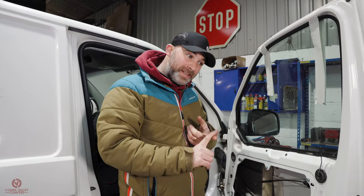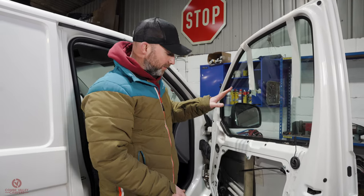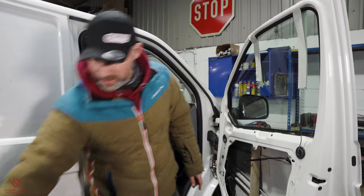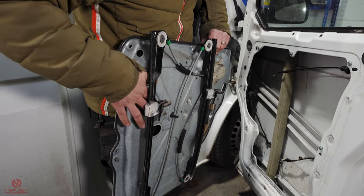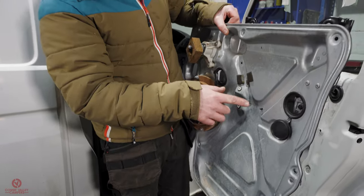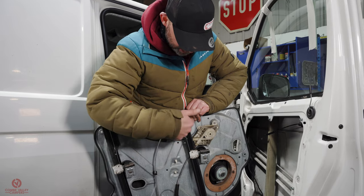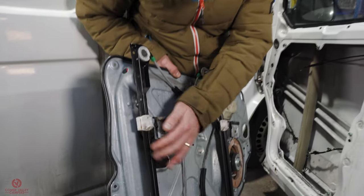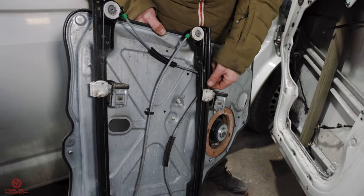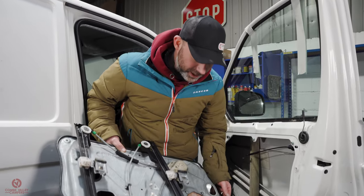Now we've got the seat back together, we've put the handbrake clip in, we've got the central locking sorted, and we're back to putting the door together. It's effectively the reverse of taking it out. We've taped the windows up and I can remove the piece of wood that's been holding the window up for two weeks. Bolt in the panel. Lower the window down to match up with the guides, clamp it together, push the glass back up, then put the door card back on. Because the runners are quite old and dry, I'm going to spray a little white grease on them so the window runs up and down smoothly — it was quite stiff before.